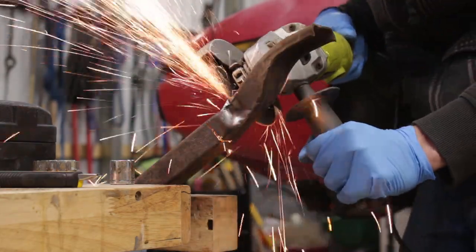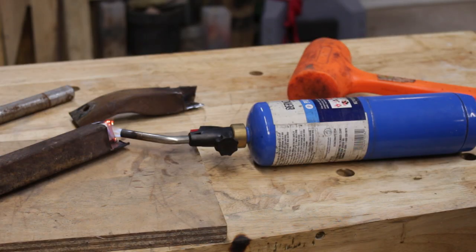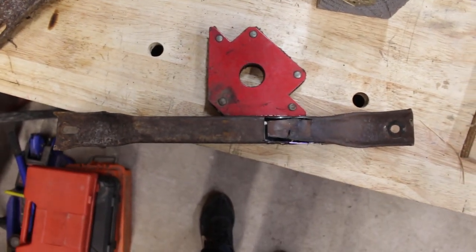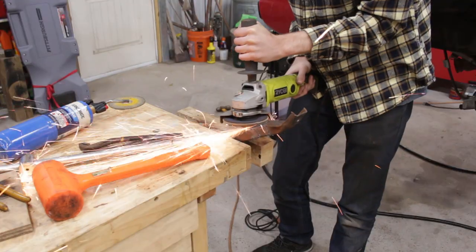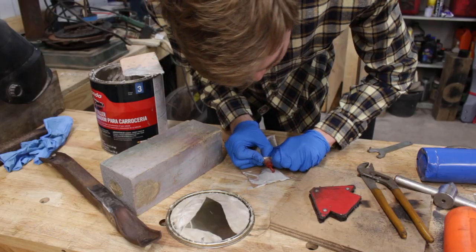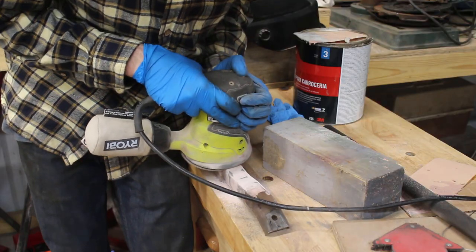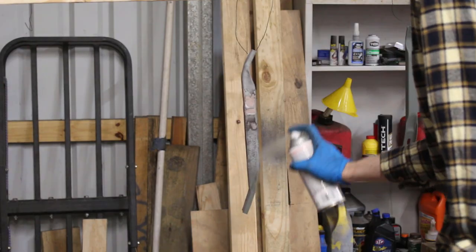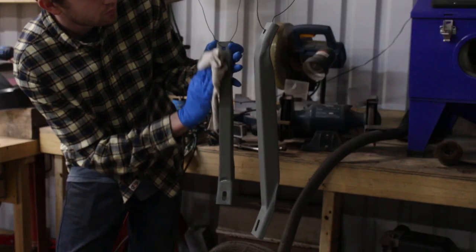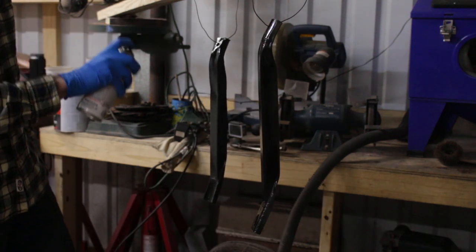I made a staggered cut with two extended neighboring sides for each piece, so that I could hammer each piece straight from the inside. Then I welded them together, ground down the welds, re-welded where there were holes, and then ground down everything once more. Now, body filler is absolutely 100% a waste of time here since this is going to be hidden underneath a car where nobody but myself will ever see it, but I felt compelled to make it at least somewhat presentable. The repair didn't result in a perfectly straight piece of metal, but it'll still be able to do its job just fine.